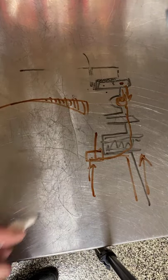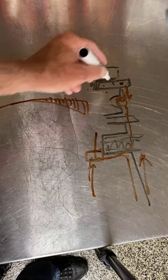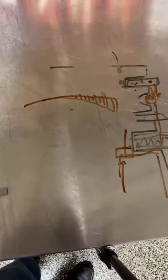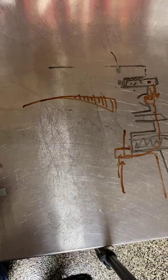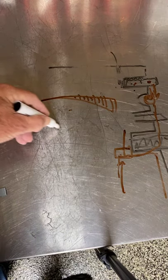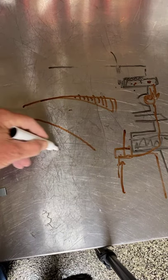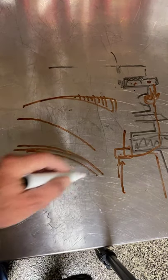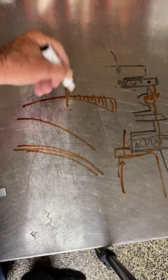It's hard to measure it on the dyno because we only go to peak, but if you go way past peak and you start working on why you lost ring seal, another thing you can do is, if you're racing down the racetrack, you guys, and you see you got crankcase pressure on your V300, going down the track in every gear it looks like this. Every gear the vacuum's going down. It's going down closer to the finish line. That's because you keep going past peak.